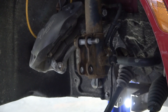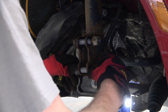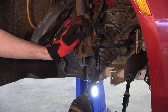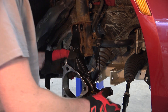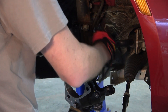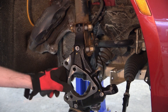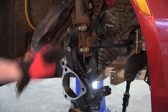I'll throw these guys back in for now because we're going to need to take the little splash shield off the old hub, off the old spindle, and transfer it over. I don't want to forget stuff or the direction things go. Now that we are done with the ugly parts, we can start to put on the shiny parts. I'm going to start off with getting the new spindle in place. We'll just tap the bolts back in most of the way and let the nut do the rest by pulling it in tight, but make sure you've got enough thread so you don't strip it out.